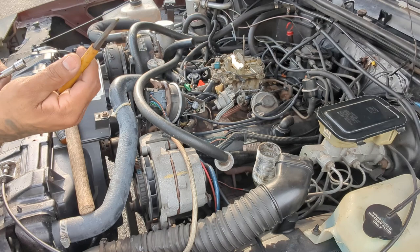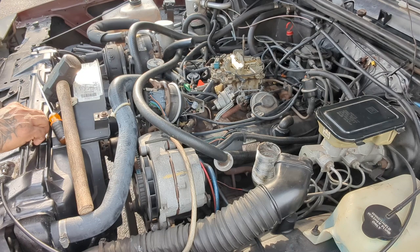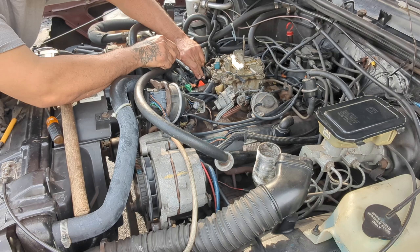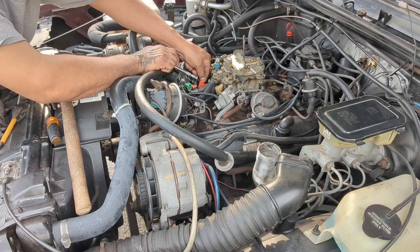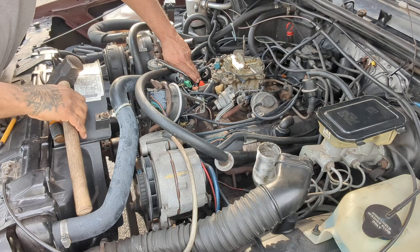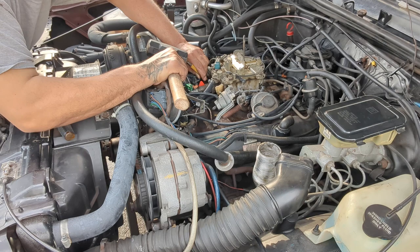Alright, I found a chisel. I'm going to try to use this. The hole punch. I'm just going to put that in there, hopefully. Put it where I need it. It already doesn't look too promising. Yeah, it's not even staying on the top of the cap. What I gotta do is make a dent in the cap so the punch will have a place to sit.